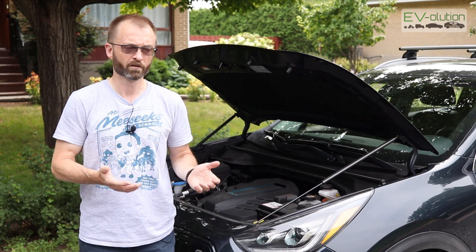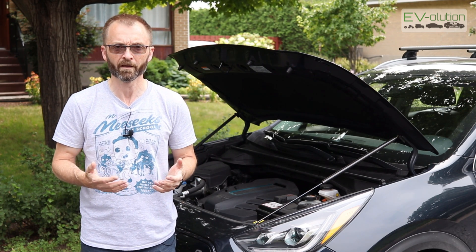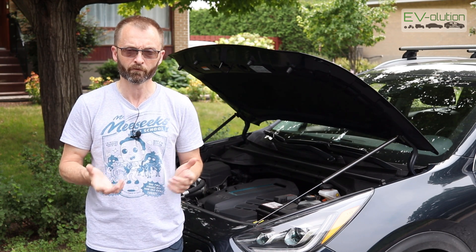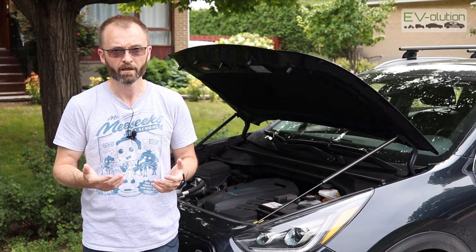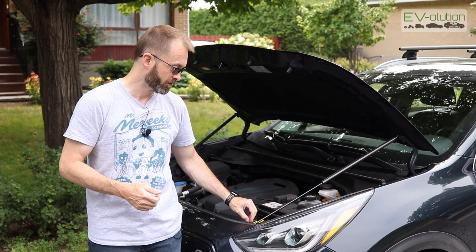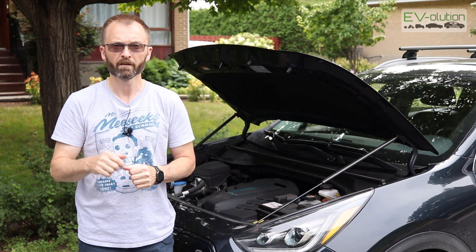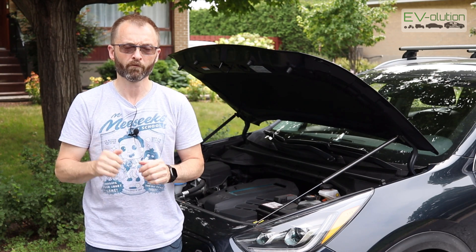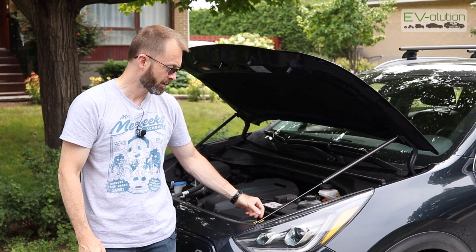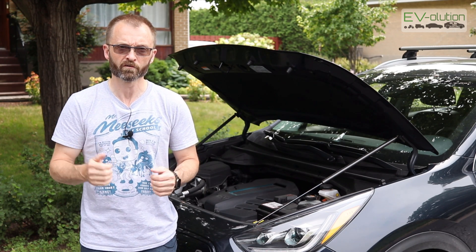So how does this influence my decision on what I've purchased, and do I regret it? Not really. They were so inexpensive that I didn't expect anything of super high quality, and honestly I don't think that anything from Kia, if it were available, would be any better because it all comes out of the same plants in China. I'll take these off — there's a little clip that needs to be popped up, then you can lift the ball socket — then I'll undo the parts, clean them off quickly, give them a quick spray paint, and put it all back together. A quick cleaning with a scuffing pad and a quick shot of paint on the arm should solve the problem.